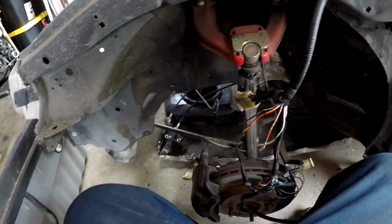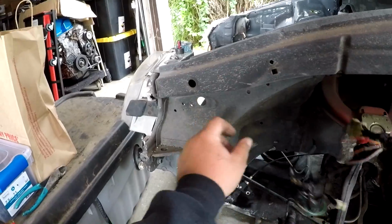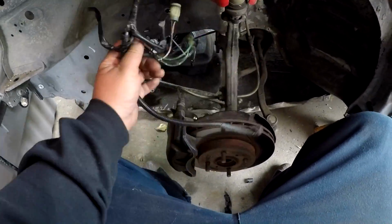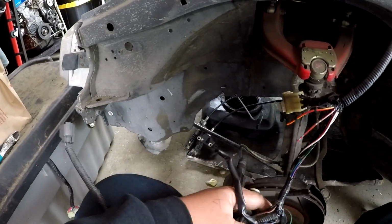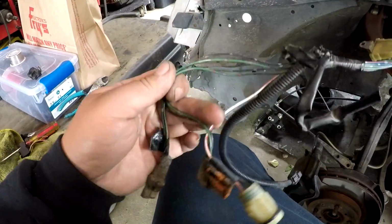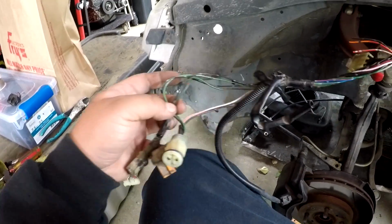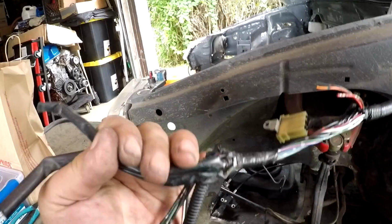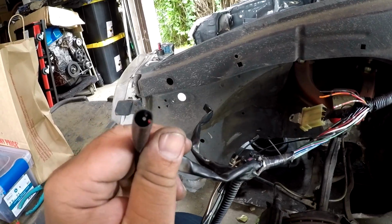And pretty much what I'm doing right now is I'm gonna wire these guys along the rail, mock it up, see how long I need it to get to the headlight, and same goes for everything else. And then this guy is the horn, which is somewhat short right there. I gotta extend that a tad bit because I do still have the horn with my Nardi. These two I'm going to tuck away. I'm not going to cut them because they're going to be open circuit. I'm just going to zip tie them together because these are for the windshield washer reservoir motor. And then we have these two right here. Same goes with the headlight. They cut the corner lamps and then they sell them with the corner lamps. And then the other one I believe is red.